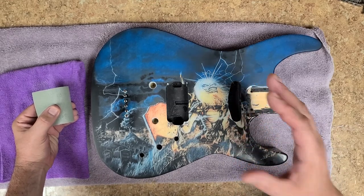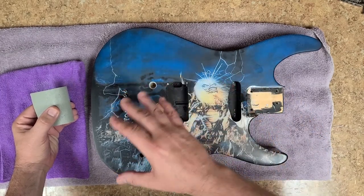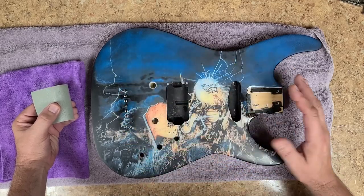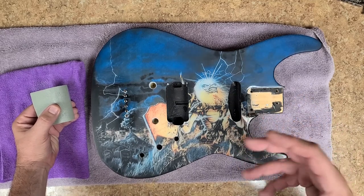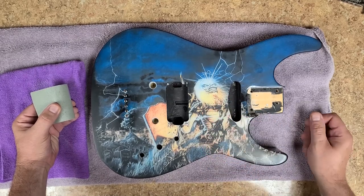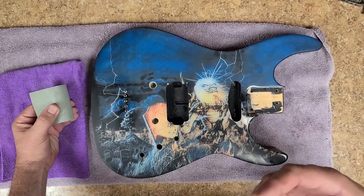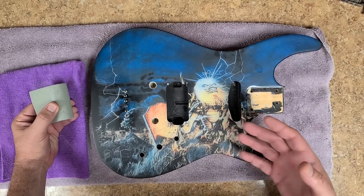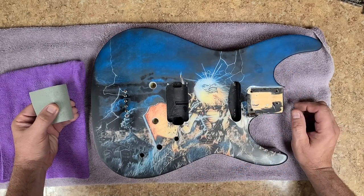If you don't take your time when sanding, and don't take your time trying to remove the sanding scratches or marks from the previous sandpapers, you're going to have hazing. It may look like it's got a nice reflection, but when you get it at certain angles of the light, it's got a hazy look. Black doesn't look black; it has a gray tint instead of a nice black finish. Even if you spray a matte finish and put some type of clear on top, it's still going to have a matte finish if the sanding and everything else is not done correctly.